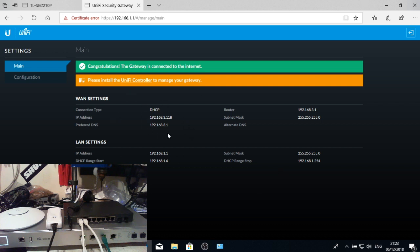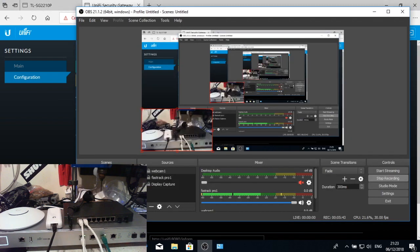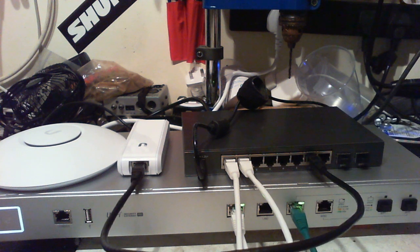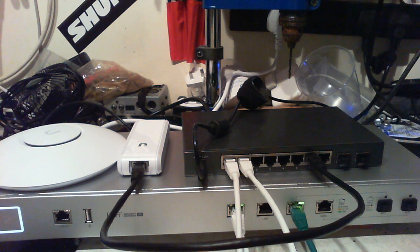In the client's environment, the WAN settings won't be using DHCP — they'll be statically assigned because they have a static external IP address, which is useful. The next thing we're going to do, before changing anything on the USG Pro, is power up the Cloud Key.